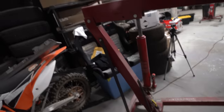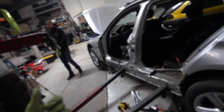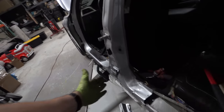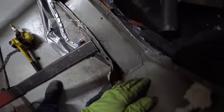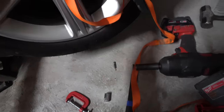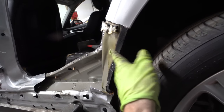Trevi's Customs is in the house with a custom frame puller. We have it pinched just above the pinch welds so it doesn't shoot up, with Ty standing on the back while I was pulling. I was basically pulling right here trying to get this post out just a little bit because you can tell it's pushed in. There's still some kinkage here that we need to figure out. The inner structure right there I'd like to leave in once we get the outer skin off. But we had an issue — the wheel key got rounded off in there so we can't get the rear wheel off.